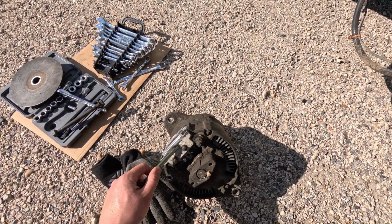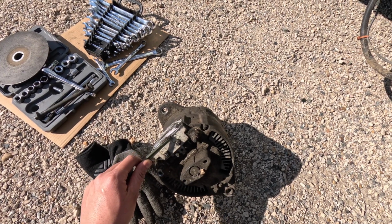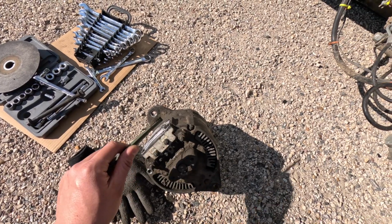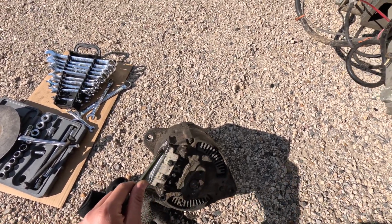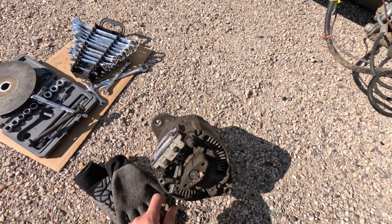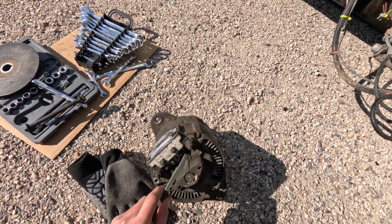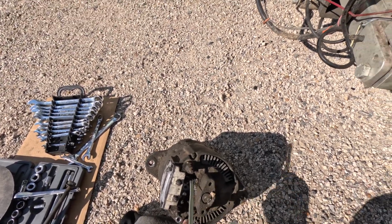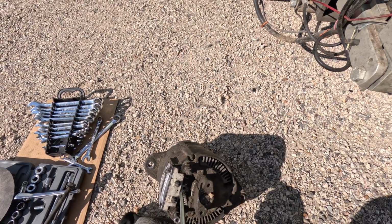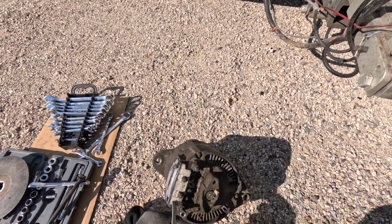This is a DUVAC. What is a DUVAC? I just did a search. It's actually a voltage sense terminal, I believe, which I don't have on the new alternator, so I have to figure out what I do here. And this one I did not find, but there are 3 terminals laid out just like this on the new alternator, so I will put the wire in the middle like the old one, and the negative and positive would stay the same.